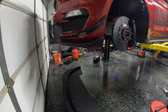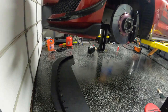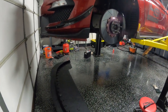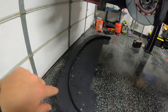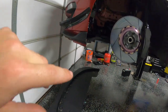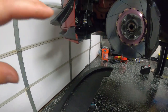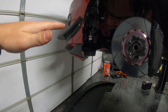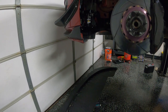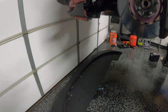I've got the front bumper loosely reattached with the belly pan on the bottom holding it in place, so we're in good shape to start final assembly. I drilled a couple of holes that I transferred over from the previous splitter — you can also do it by transferring from the belly pan. If you're making your own for the first time and you have no belly pan to transfer holes from, you'll need to figure something else out. I just transferred the pattern from the belly pan onto this, and then did some countersink holes on the bottom.